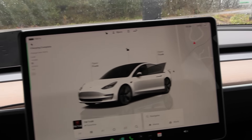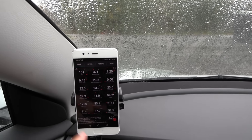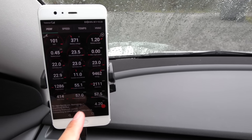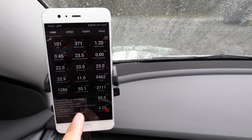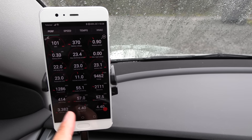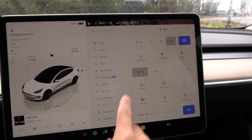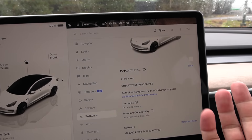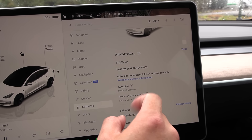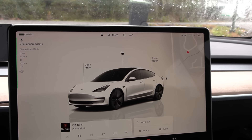It finished charging not long ago. I don't want to stay here too long because it might have a slight drain when stationary, but at least it's connecting. You see here: 57 kilowatt hour nominal full pack. When it was new, I measured 56.9 kilowatt hour with losses, so we'll see how much we get out of this battery. If you go to software, you see 61K on the odometer — LRW, this is from China. So we'll prepare now and start doing the test.